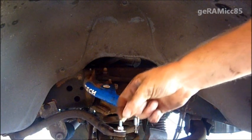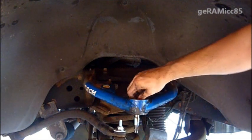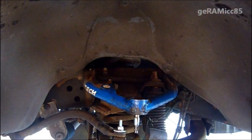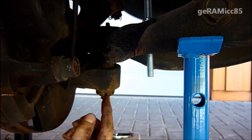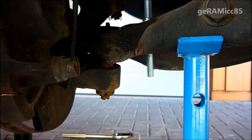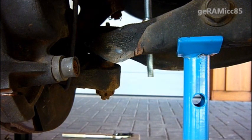The first thing I'm going to put on is the grease nipple. I'm going to screw that in hand tight for now so that no dirt is going to come in there. Next thing I'm going to do is take out this lower ball joint, so I'll loosen up this lug nut first. This is a 27 millimeter socket so that'll do it.